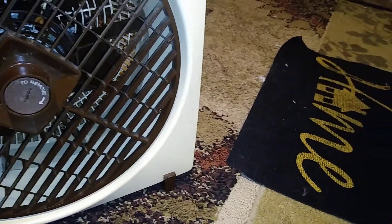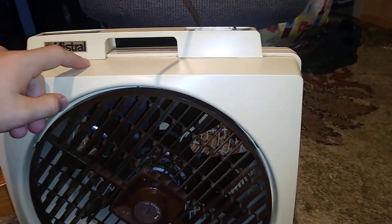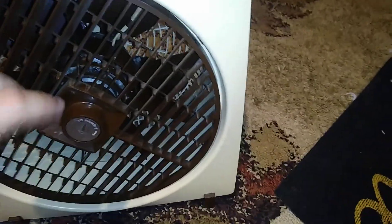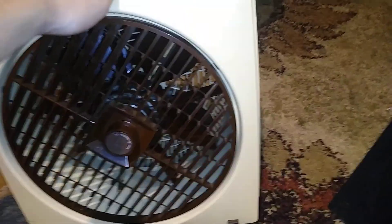People may have thought it was the motor catching fire, but that is actually not true — it was the switch. The switch overheats and the little conductor inside there melts, and it ends up catching fire, and the whole switch and then the whole fan. They opted to have these destroyed — not just thrown out, but actually demolished, smashed up and broken so no one would use them.